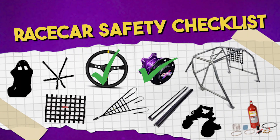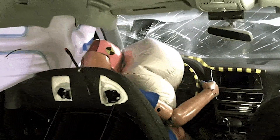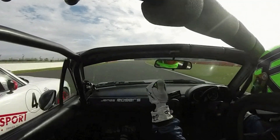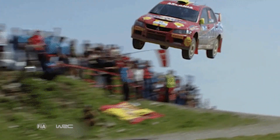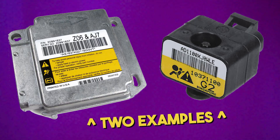So with the quick release and the wheel installed, we are finally on the last portion of the checklist, crossing off the last three items: your bucket seat, your harnesses, and your HANS device. When we talk about replacing airbags with race car safety equipment, these three items are typically what people are talking about. We all know the job of an airbag - when you get into an accident, it detonates, inflates and prevents you from smashing into your windshield or steering wheel. When it comes to race cars, there are things people don't think about. If you're trying to do something like rally cross where your car may be leaving the ground, a lot of airbags are actually triggered by G-force sensors or impact sensors. So if you take your car off a jump and you land, you're very likely to deploy your airbags - and that is the last thing you want going 60 miles an hour over a jump with a hairpin turn coming up next.